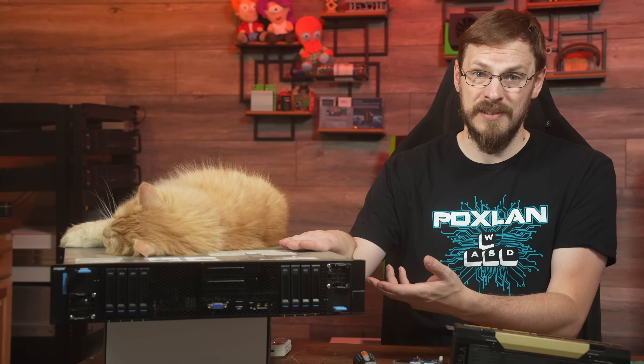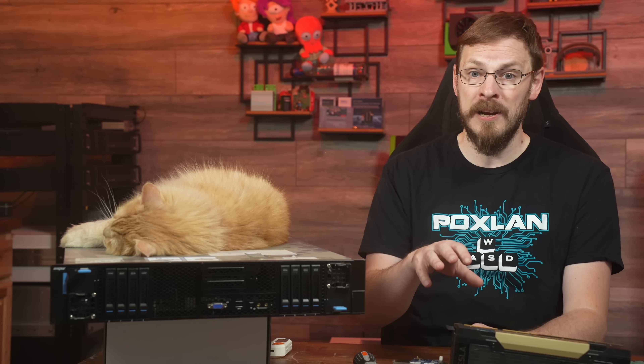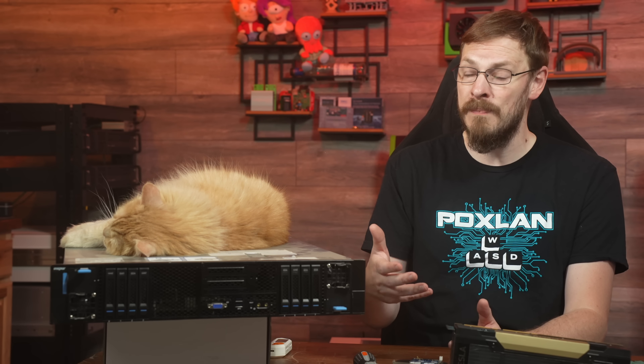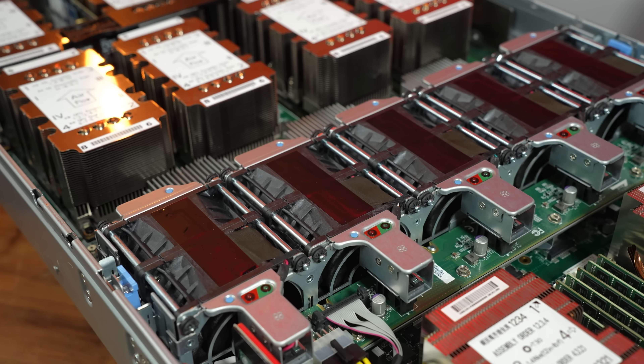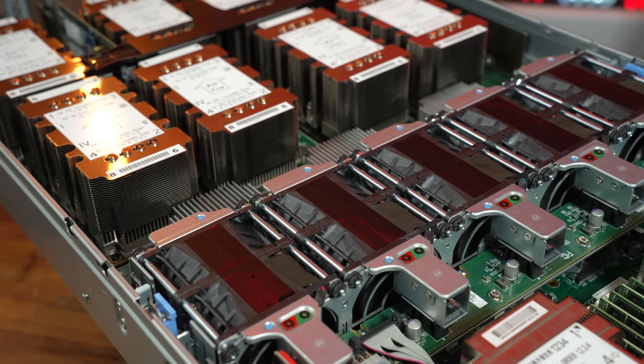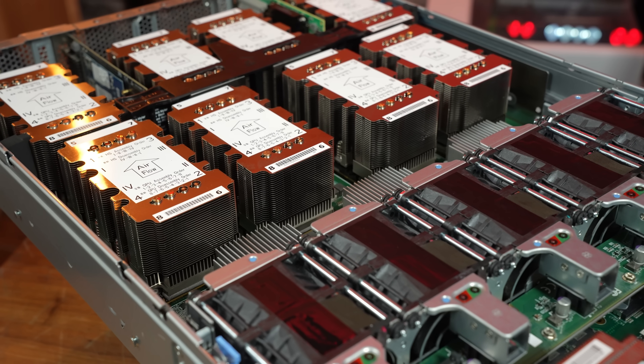Graphics cards were simply too big to cram any more into a smaller space, so NVIDIA designed a new GPU interface called SXM. This transformed the traditional PCI Express GPU into a mezzanine-style card which can slot onto purpose-built carrier boards. Rather than each GPU having power delivery circuitry, external power connectors, PCI Express controllers, or anything else that takes up space, these new SXM cards were essentially just GPU dies and memory on a much smaller package. That means no more bulky cabling, fewer overall components on each card, and a new platform where you can fit double the number of GPUs into the same 2U space.